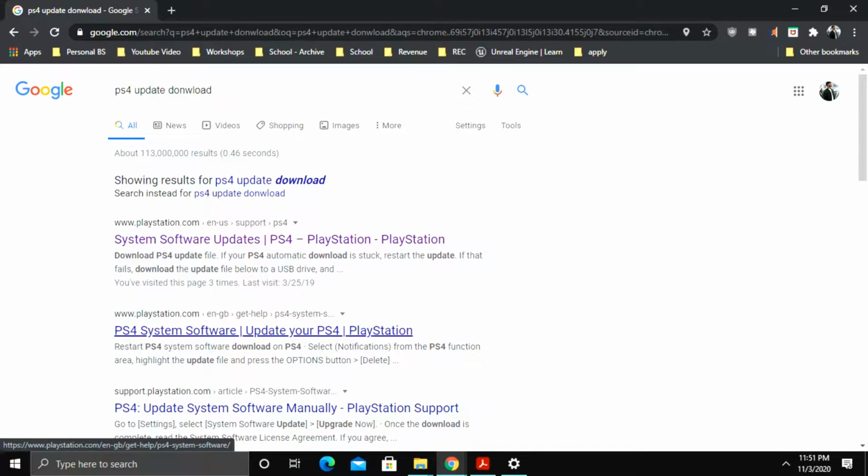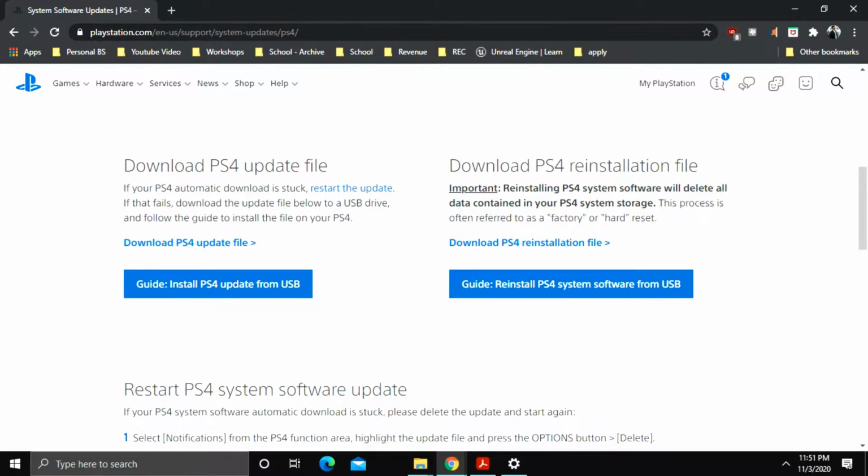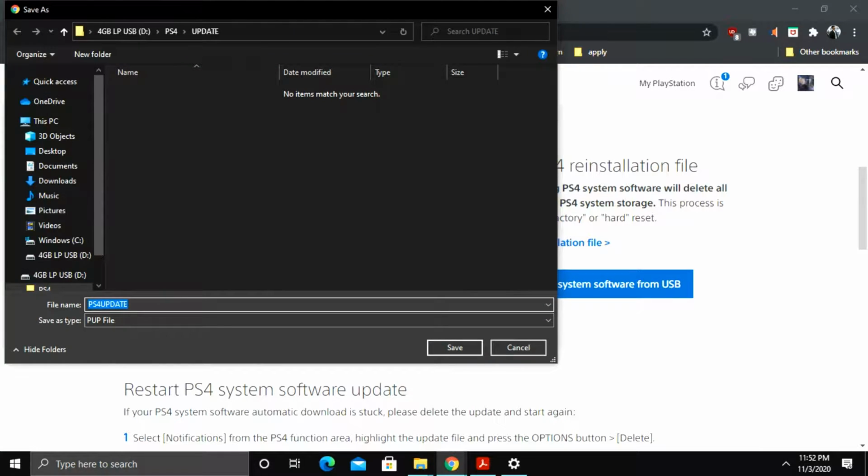This is English US, so I'm going to use this one. You might use a different one. It might be like Asia, Canada, or European Union or something like that. So I'm going to click on this right here. And this is where you want to be careful, because we want to download this right here, the PS4 reinstallation file. This is going to be the full firmware, and this is going to be a bigger file. This is just the update from, let's say, 7.5 to 8, or something like that. And if you put this on an empty hard drive or solid state drive, it won't work. So download PS4 reinstallation file. And then this is going to be in the 4GB flash drive, in the PS4 update folder, and it's going to be called PS4 update.